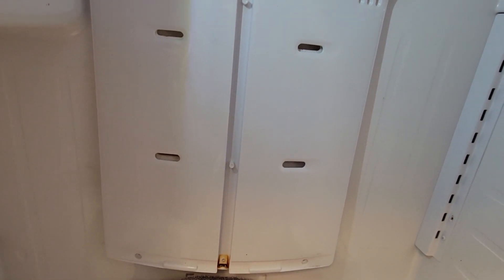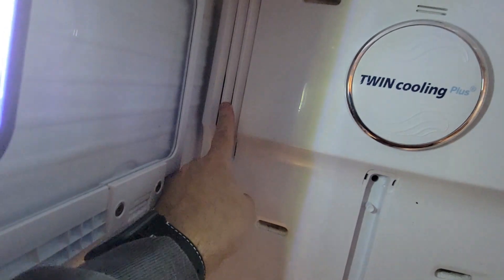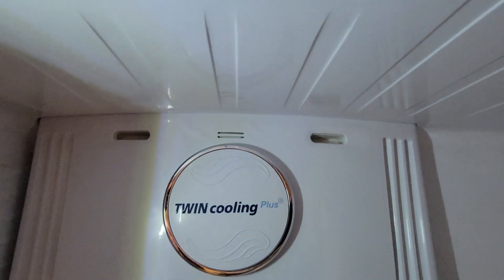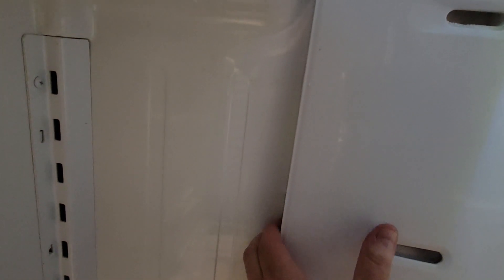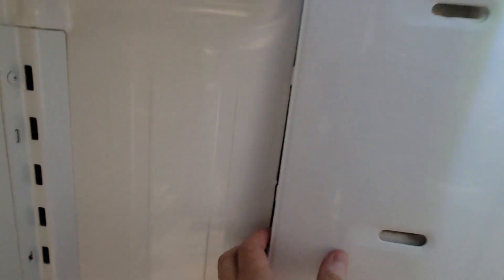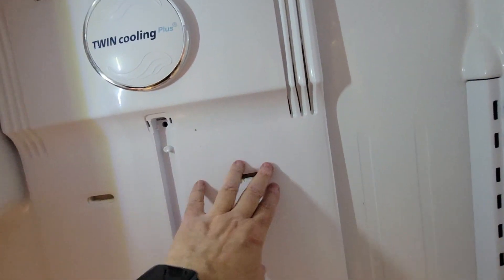Okay, it's been about an hour, maybe an hour and a half. I've been using a hair dryer because the styrofoam is staying stuck back there. So I've been using a hair dryer blowing hot air through here and these holes here. Because the styrofoam should be coming out with this plastic. This whole plastic, when you take the screws out, you should be able to just pull it straight down and it should come out from the top. It's not. But I just had a breakthrough — I just got a hold of a piece of styrofoam here and pulled on it and it's starting to come out. I heard a piece of ice fall. So if you have the same problem, don't try to force this plastic out, you might break it. Just use a hair dryer on it if you want to speed things up.